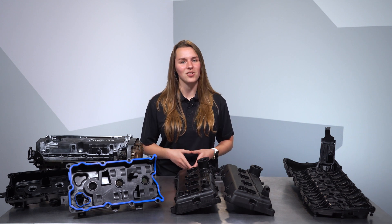However, the valve cover quickly became an integral part of the very first emissions controls. In the early 1960s, the PCV valve began replacing the road draft tube. Oily blow-by from the crankcase was no longer routed to the atmosphere, but instead recaptured and routed back to the engine. That PCV valve was plumbed to the star of today's show — the valve covers.